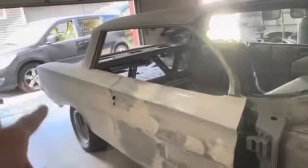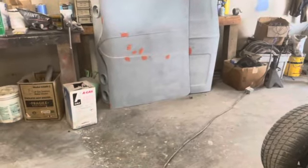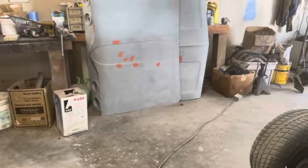I think I am going to go ahead and paint the underside. Once all that's done, I'm going to paint the underside of the hood and paint the underside of the deck lid separate from the top. I kind of figured once I get the trunk channel painted, I'll paint the underside of the deck lid. And then I'm going to try, I think it's called wet on wet, where you just rough the whole thing up with some 180, and then you take epoxy primer, shoot it wet, wait whatever the drying or flash time is, about 20 minutes, and then shoot the paint right over it. Because it's inside the trunk lid, who cares really, but I got enough paint to do the inside of it.